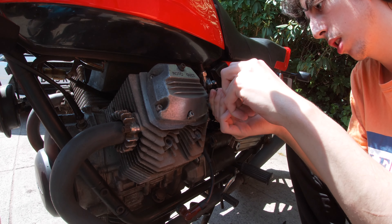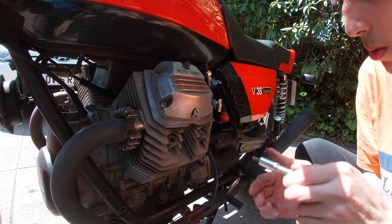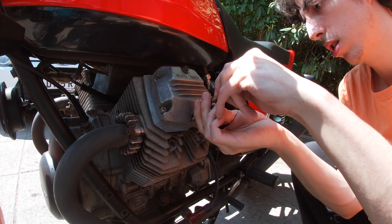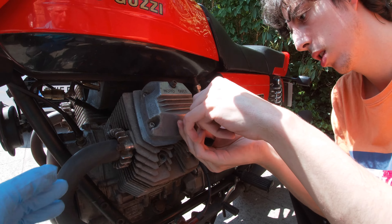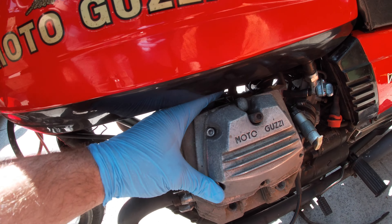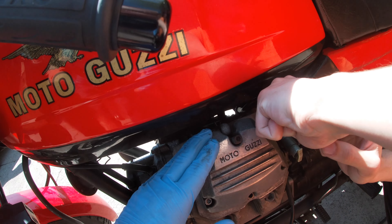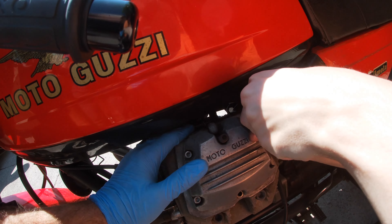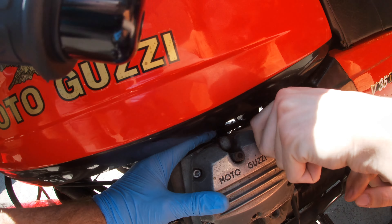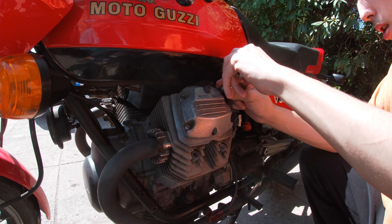They should all be the same length, the top one — yeah, they should all be exactly the same. And then to remove the cover, up here you can see there's an oil supply that actually helps to put negative pressure into the cam cover to help the oil flow. So you've got to undo that — basically what you've got is a rubber hose with a clamp there. You've got to undo the clamp with a pair of pliers once you've got these off. And then we've got the valves.